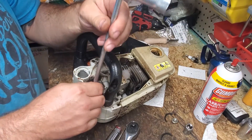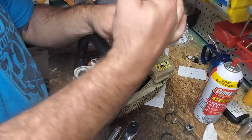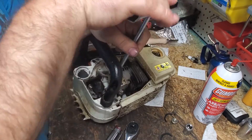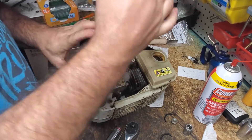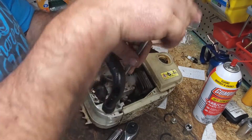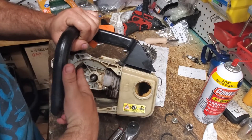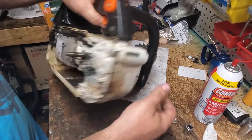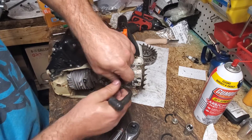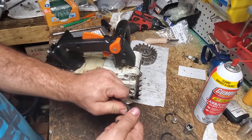Although I don't have to put a ton of money into this saw, I did notice some initial surface scores on the piston, and I think that's just because the saw hadn't been started in a long time — that happens a lot when people let stuff sit. I ordered a set of three aftermarkets and I'm just going to include an extra one with the saw. You can lift your coil out, but they fed it through the chassis on this one, over to the other side — so you've got to pop this off.